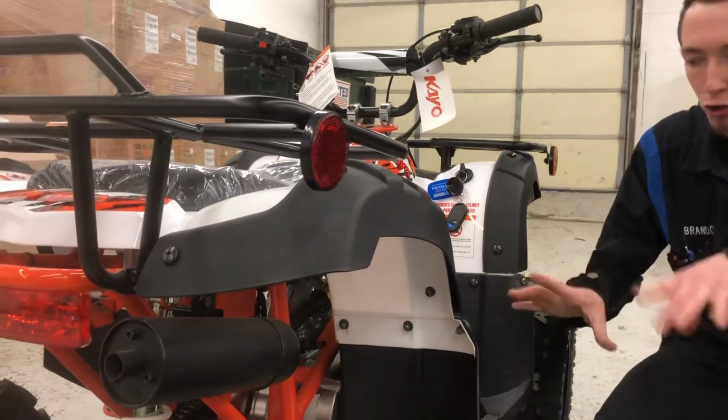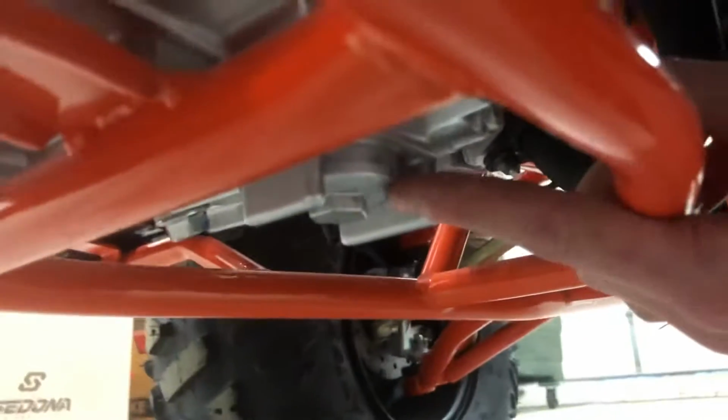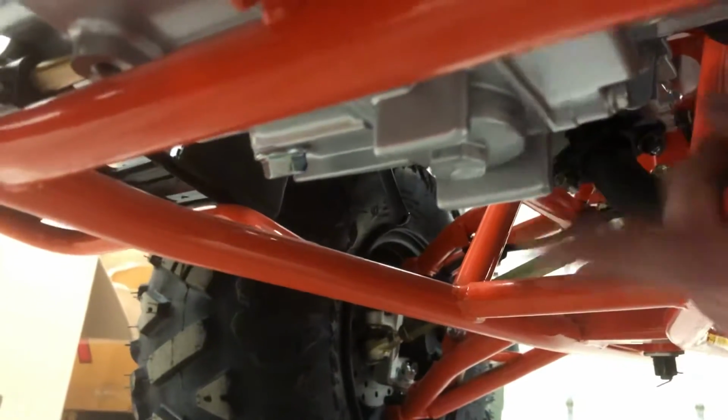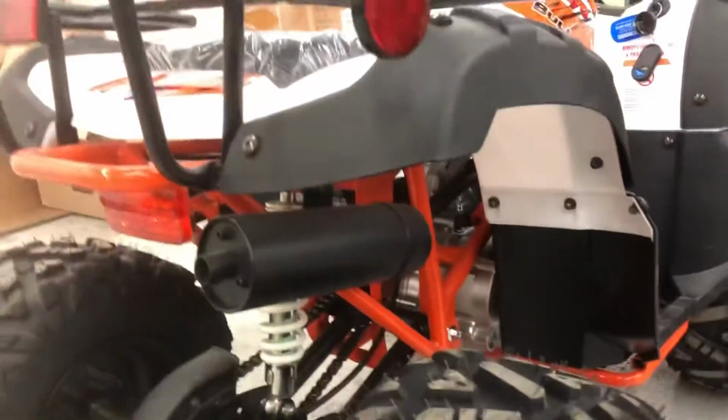Okay. And then as far as draining the oil, you've got your drain plug, which is right here. It's got a big washer on it. It's a 17mm drain plug. Yep, right here. This guy right here. And there's a spring and a small screen that will come out with that. You just have to make sure that stuff goes right back in there. The spring keeps tension on the drain plug so it doesn't back out. The screen acts like an oil filter.